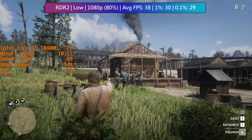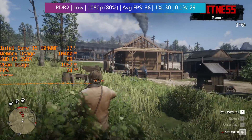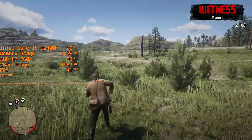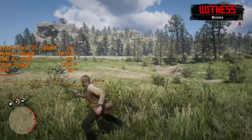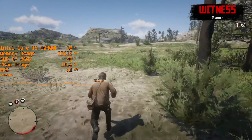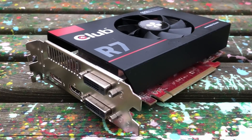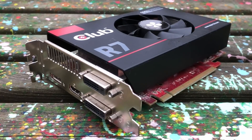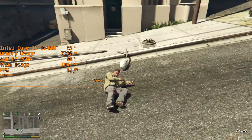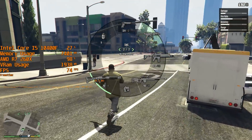From what I've seen, the R7 260X is a bit cheaper on the used market right now than a 750 Ti, and for that you'll get similar frame rates, but you will need a spare six-pin connector from your PSU for most if not all models. Also — and this is very important — make sure you get a two-gigabyte model, because a one-gigabyte card will cause serious problems with frame rates and frame times. The R7 260X two-gig version is the one you want. The 750 Ti is a more commonly found option, so that may be worth going for instead — both are close in price and still supported by their latest respective drivers.